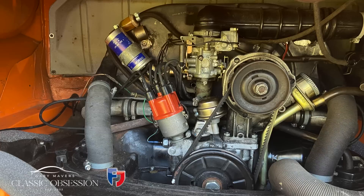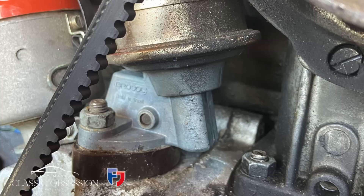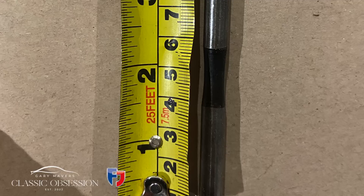Along with a new coil, brand new ignition leads, and a new fan belt. Next was the fuel pump. Even though it looked brand new, I decided to replace it — and I'm so glad I did, as it was absolutely shot, along with its Bakelite stem, or pedestal as it's called, which had split into little pieces.